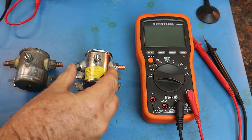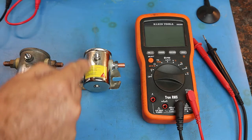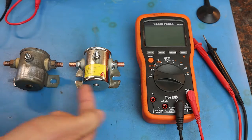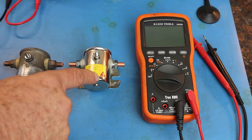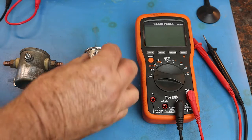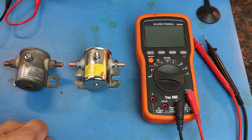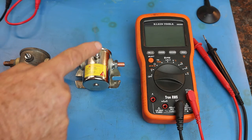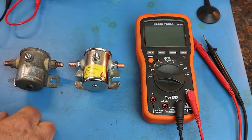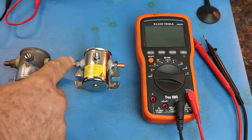How does it do that? A solenoid in this little container has a lot of wire wrapped around a metal piston, and when you apply current through the wire inside this canister — and that wire is in the shape of a coil — it applies a magnetic field to that coil of wire, and the piston inside is then attracted by the magnetic field. It moves the piston into a position where it closes these contacts and allows current to flow through these large terminals. The minute you remove the current through the small terminal and ground, the contacts open and the current stops flowing.